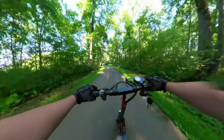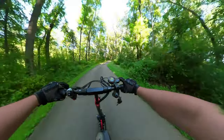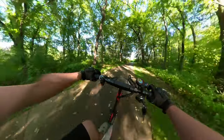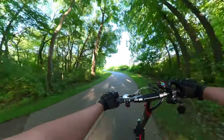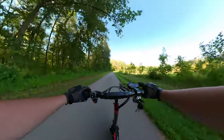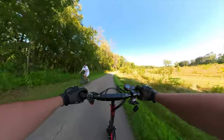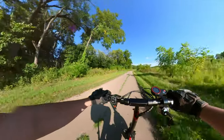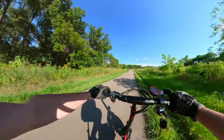The scooter is more built for top speed, not for torque. What that means is there's a motor KV rating, and they can put in different motors based upon whether you want more torque or more top speed — they're going to use the same amount of wattage but have different effects. This is definitely a KV that's more meant for high speeds, which gives it higher revolutions but less torque. That is the trade-off in electric motors: you take your choice — you want more torque or you want more high speed. The only way to get more of both is to push more watts and get a bigger motor.